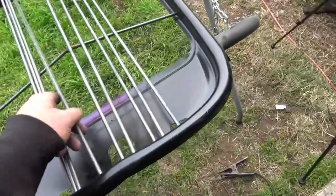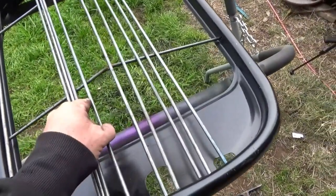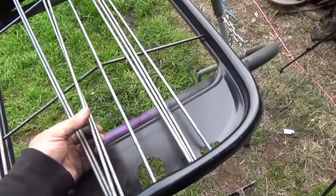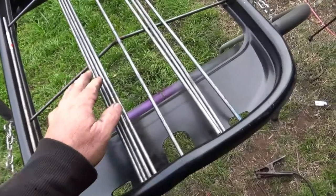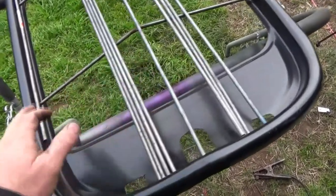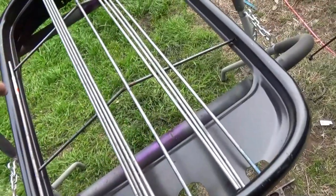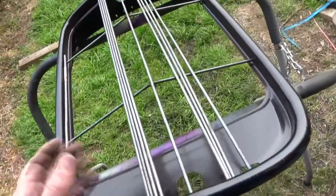With maths, yeah, believe it or not, I've worked out that I need one of these every 2 centimetres. Don't ask me to convert that to inches, because I wouldn't have a clue. So I've just cut 9. They're all the same length, which will do the first lot. But what I'm going to do to make it as even as possible now is just confirm my maths, because my maths isn't excellent. And then I'm going to make a spacer, so every single one of them will make up 2 spaces, so they're all exactly the same distance apart, because you will notice if they're not.